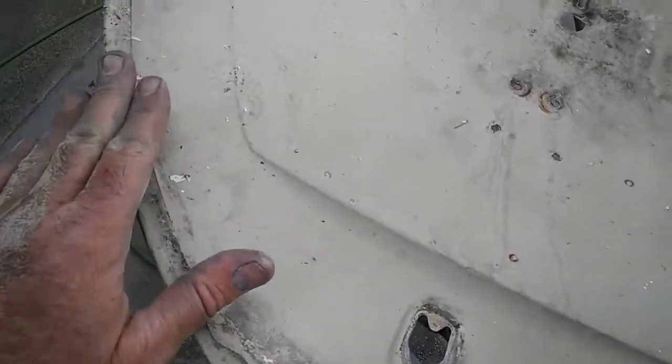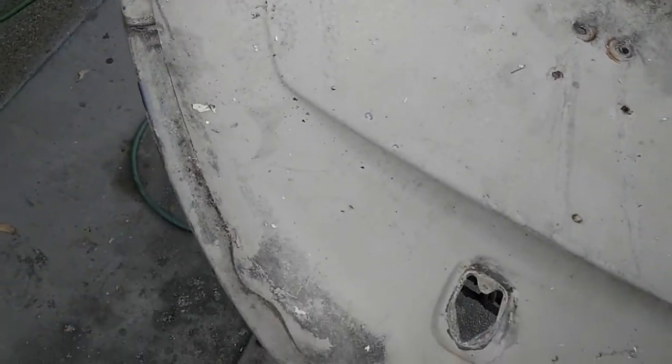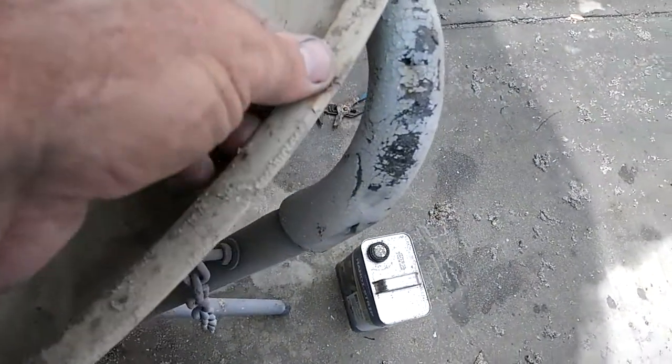But on the deck lid, since when you have the deck lid open this is a very focal area, what I'm gonna do is cut a little strip and put it up behind here and just weld it in — spot it here and here. That strengthens it up a little bit but makes it cosmetically look pretty original.